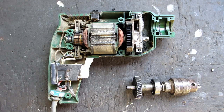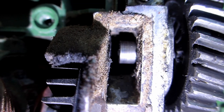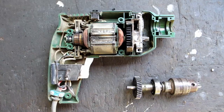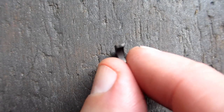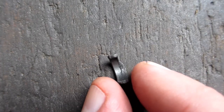I cracked it open, but when I checked the output shaft bearing it seemed alright. I put it back together, and that's when I noticed the shaft flogging around on the inner bearing — just a big hole with no bearing. This was weird, because the screws cracked like it had never been opened before. All I found inside was a half-round thing that looked like a ferrite bead, which if it's the bearing must be something like a cast iron bush.